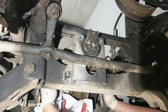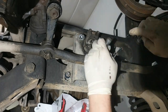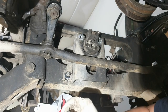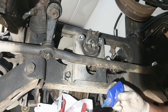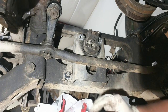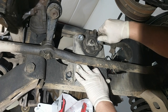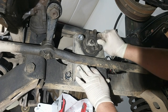I've got the four bolts into the brackets on the side of the diff. Now I'm going to use these two bolts to put in to the top. These two bolts on the front diff only do not require washers. That's why we left the bracket loose — so we could line that up. Just make sure to put your Loctite on it. The reason we cleaned these so well is so I can just finger-thread them in and not fight the old Loctite. I put a pretty good bit on here because it's a really big bolt. It makes the installation process so easy.